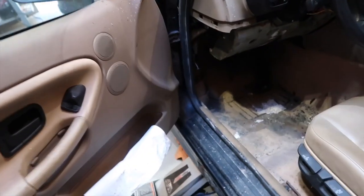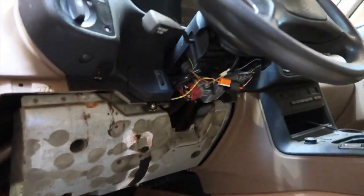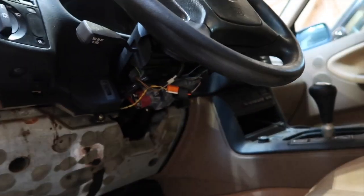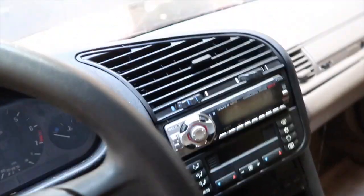The only thing I do like about it is it's manual. I kind of took the interior apart — we can just open this door right up. I took the interior apart because the hood wouldn't open, so I just grabbed the latch right here and pulled. I took out all the plastic right here and exposed all the wiring because we're having an issue where it won't start.